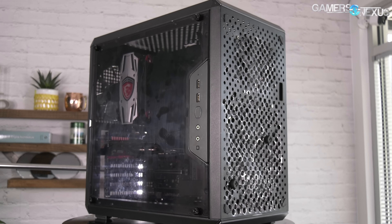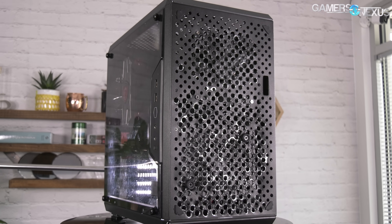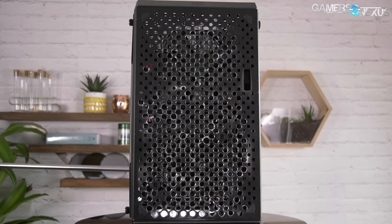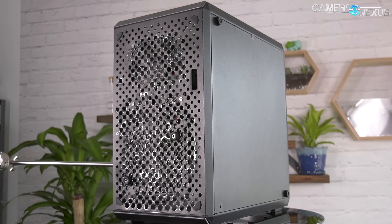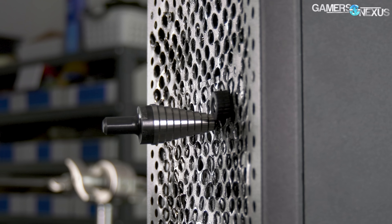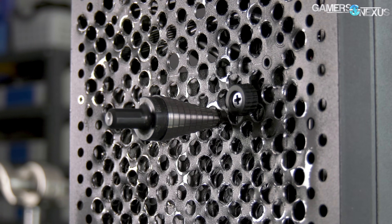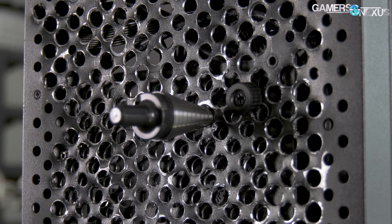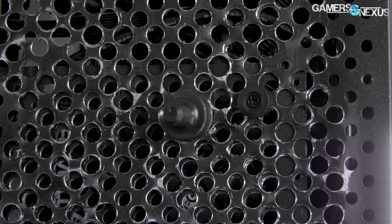The panel is not detachable and loses structural integrity as pieces are removed. But the goal was to determine if bigger holes would be sufficient for improving thermals — going back on our original plan to make one giant gaping hole, since we already knew how that end result would look. This gives us something unique to see if Cooler Master had simply widened everything, whether it would have worked out better for them.